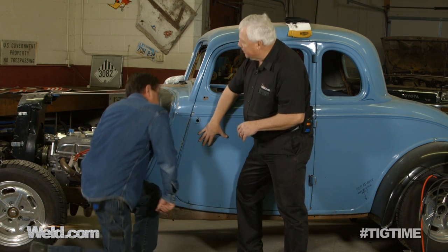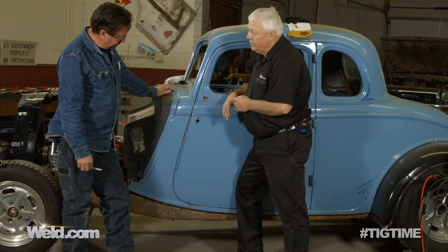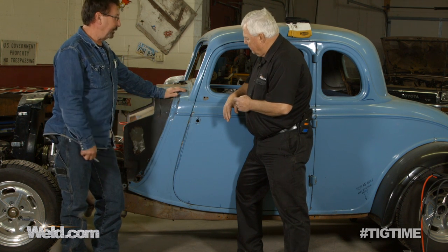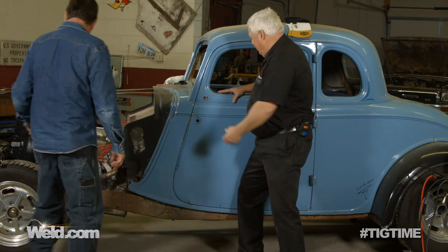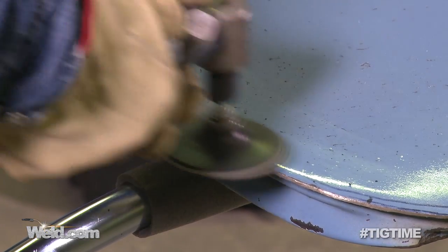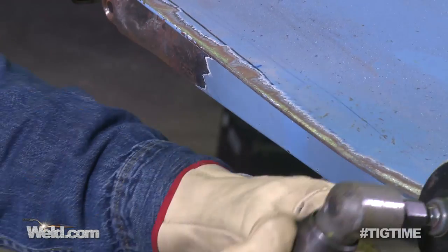So what kind of sanding do you do to get rid of the paint? I'll use a small air grinder with some grit sandpaper, just sand it off, get it down to bare metal — both sides and the edge of the door where you're going to be welding. Let's start taking this door off. Now Tommy's prepping this door so I can do my TIG welding on it. He'll get all the paint off and get a clean, clear metal surface, and a good place for me to ground to.